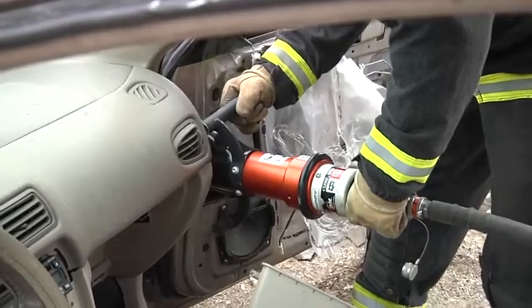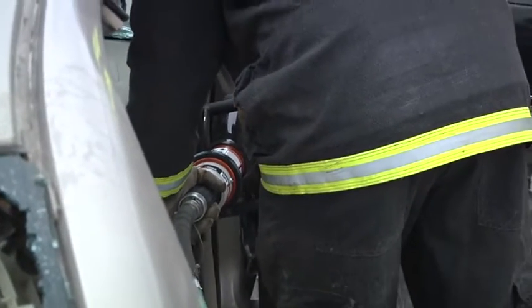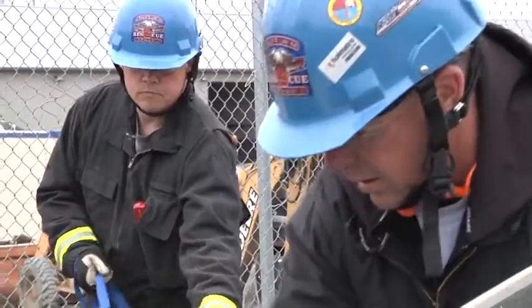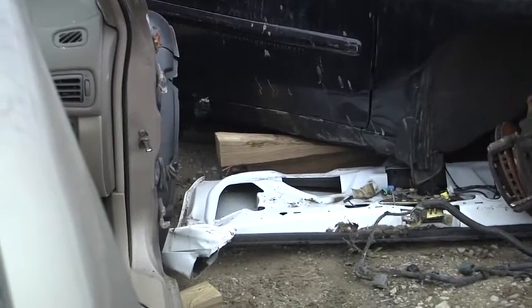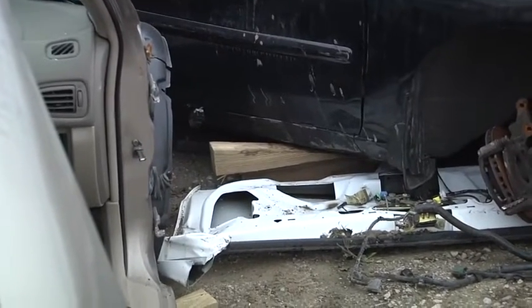As you can see, by cutting the hinges, each time he takes the tool out, he opens it to the full position. Spreaders get put in the full closed position. Now with the door off, the entire side of the vehicle is accessible, and we can take the patient out in a safe manner.